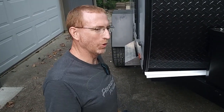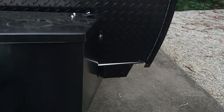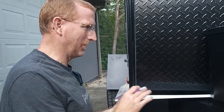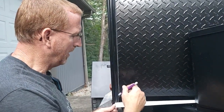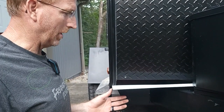Once we get under the lip, I think we're home free. What I was afraid might happen did happen — I didn't rehearse this, so this is on the fly. I've got this all the way over to the driver's side edge and because of the two Z-bends, it takes a thin piece of metal and makes it very rigid. So now I cannot bend this piece without distorting it, and once it's bent it's bent — I can't physically get this to lip underneath. So I'm going to have to simply trim this off right here and then split the difference on each side to get the most protection we can, and seal the corners off with a good quality sealer.